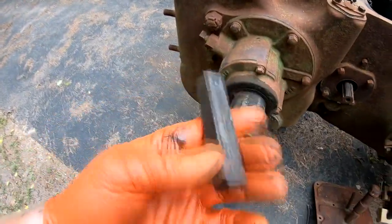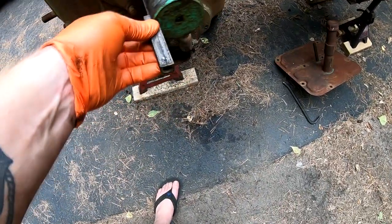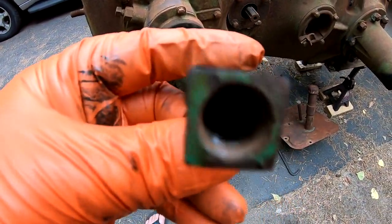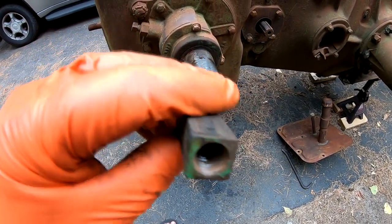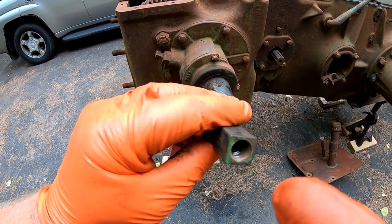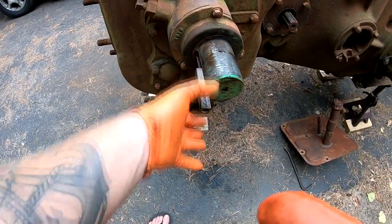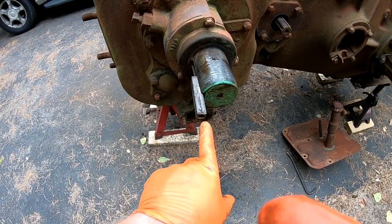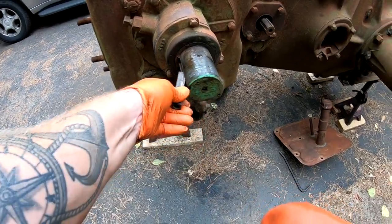This is the key that goes into the keyway on the crank and holds the flywheel in place. The end of it is threaded with a half-13 hole. What I did to pull this key was I obviously cleaned it out with a tap, then threaded a half-inch bolt in with a nut and a washer, and put a socket over it - bolt and washer through the socket and into the key - and I just used that as a puller. That pulled the key right out.